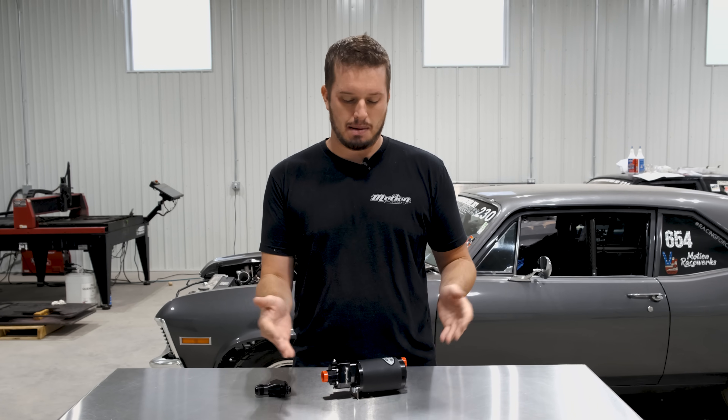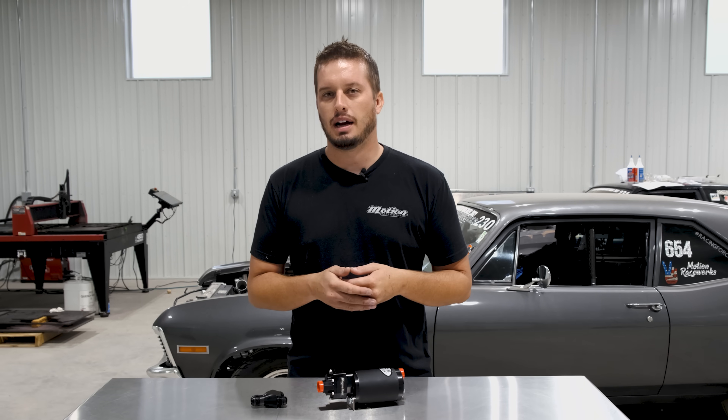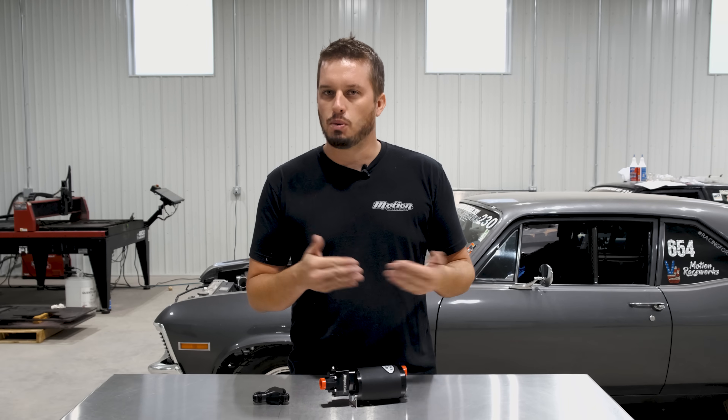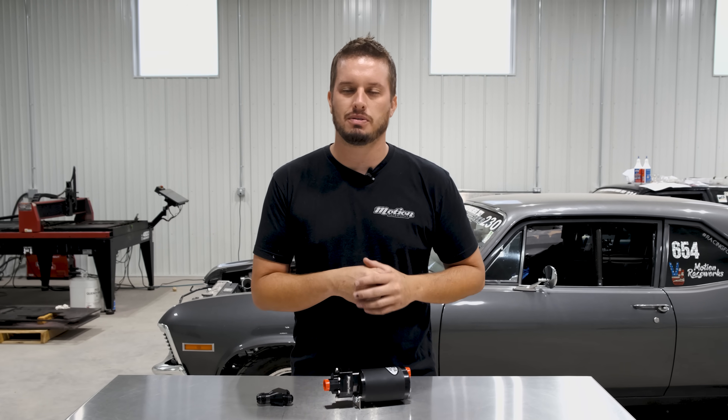I'm going to go ahead and step up to a pump. The next step up from the 4303, in my mind, is always a five-gallon-per-minute external Aeromotive brushless pump. It's tried and true, and it almost fits identically in the same place. One thing to consider is it's a good time to upgrade your filters as well, because it needs extra flow — but that's for another video.